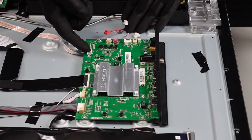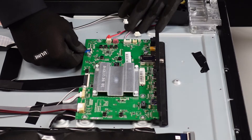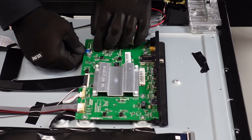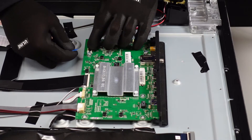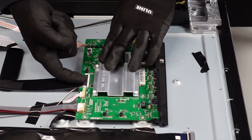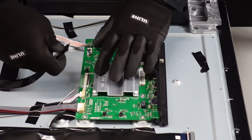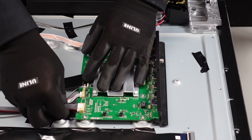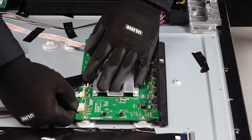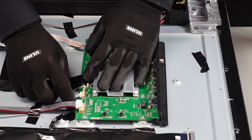This is going to be just a little ribbon cable — we want to pop that flap up with our fingernail. These smaller ones tend to be a little bit more difficult to remove, but they come out really easily nonetheless. This one's the same way — pop the flap up and just slowly work that out of there. No problems. This one right here is going to be depressed with our thumbnail and then that releases the lever, which allows us to pull it away from the board.